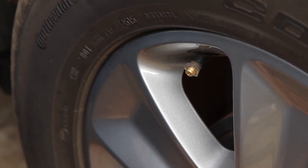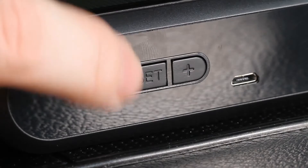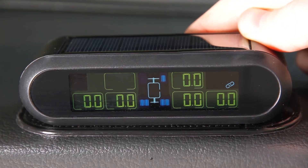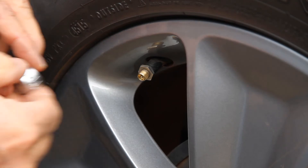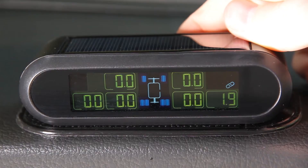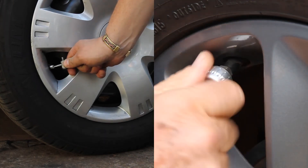When one or more sensors need to be replaced, the new sensor must be registered to the monitor. To register a new sensor, hold down the set button until the screen displays bar or PSI, then press the minus button three times — the screen will display all six sensors as 0.0. Press the set button once and the first sensor will start to flash. Using plus or minus, select the relevant sensor to be registered. For internal sensors, inflate or deflate the selected tire slightly until the monitor makes one beep. For external sensors, screw the sensor onto the valve and the monitor will make one beep. The relevant value will now be displayed — press the set button to confirm, and repeat as necessary for each tire.